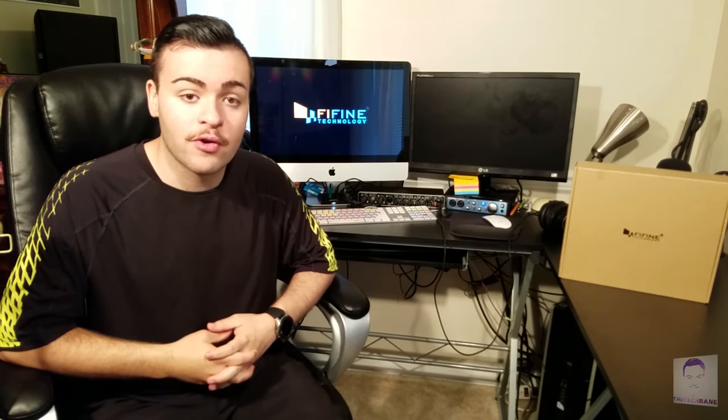I've been using the MXL990, and you've been seeing it for a very long time with the microphone being on the side right here. For a few videos, it was nowhere to be found because it was over my head like this, and well, that didn't go well. Both of these audio interfaces are connected to a hub right over here under the Mac, and they are connected via an aggregate driver, I guess you can call it. On the Mac, you can create an aggregate, and I combined the two, so I have 1, 2, 3, 4 through this, and then 5, 6 through that, so I have 6 audio inputs for recording things or for anything that I need it for.